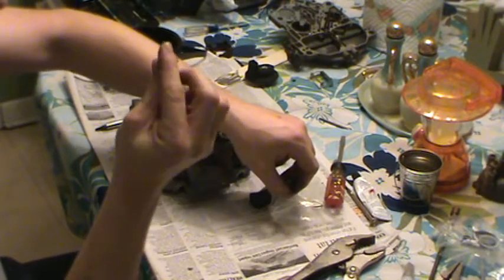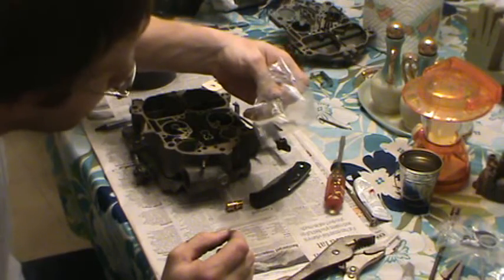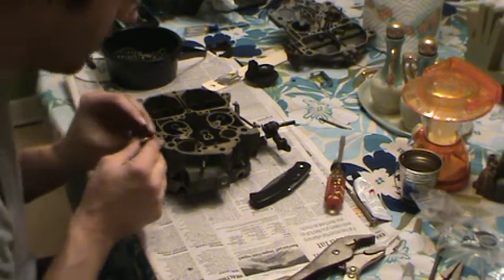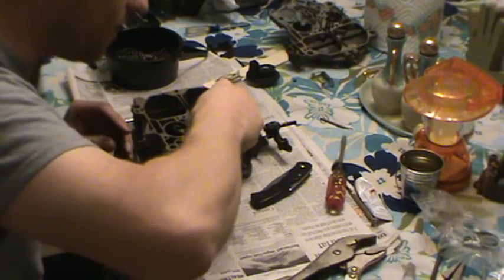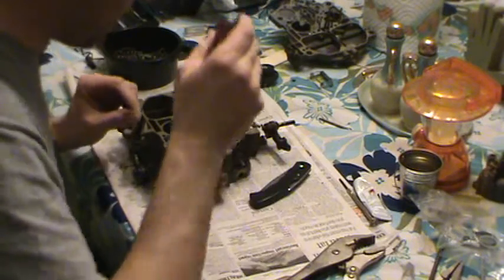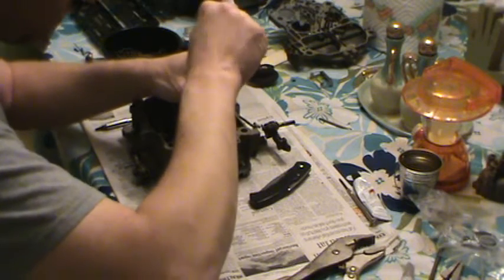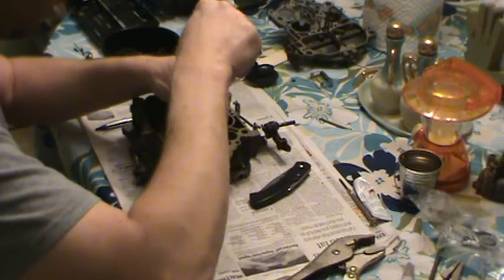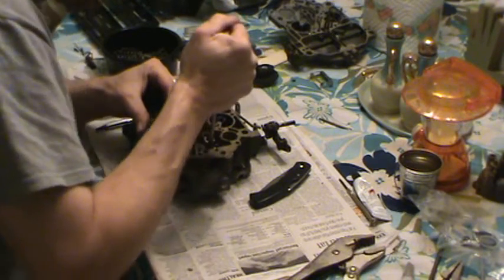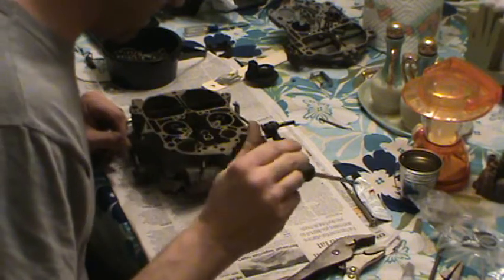So take out your new seat and take out the little washer and leave the rest of it alone for right now, because you don't need it yet. Alright, what I do is just put that together right there and carefully, smooth move there, just drop it down where it's supposed to go. Take a screwdriver and get on one of these slots. It may take you a little bit to get it started. Just use a very light touch, so it just starts screwing right in. Alright. It's okay to go ahead and tighten this up like this. But try not to slip your screwdriver down in there where the needle rests, because you can mark it up.